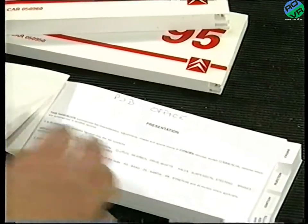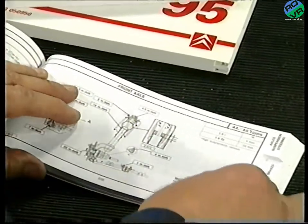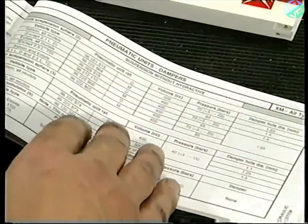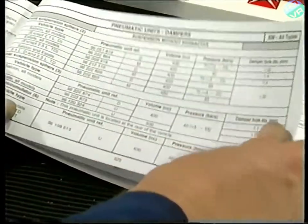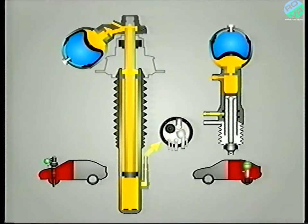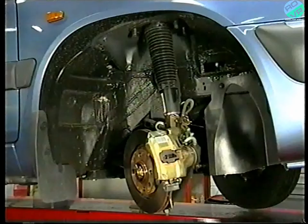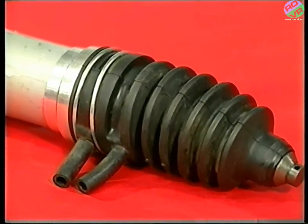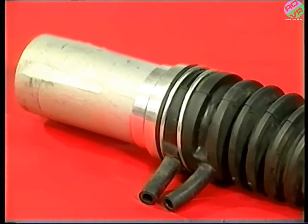The Technician's Handbook lists, over several pages, the variations for both Citroën Xantia and Citroën XM. So make sure you order the correct part — it's not simply a case that all Citroën Xantias have identical front suspension spheres. The suspension cylinders differ front and rear, but work on similar principles. The steel front units are non-serviceable, whereas seals and gaiters are available to repair the alloy rear cylinders.